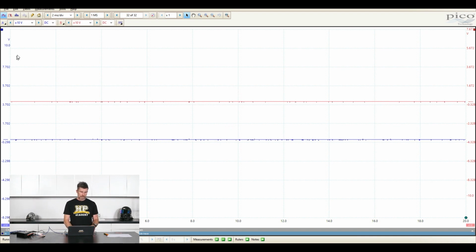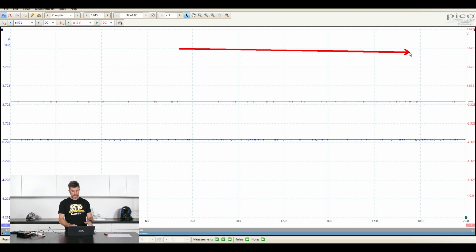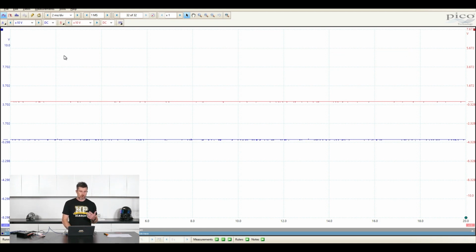So on the left hand side here, we've got our voltage axis. You can see obviously it's in blue representing our channel A, and on the opposite side over here we've got the same for our channel B. So we've got the ability to control the axis as well. So for example here we can see that our channel A voltage axis is spanning plus or minus 10 volts.